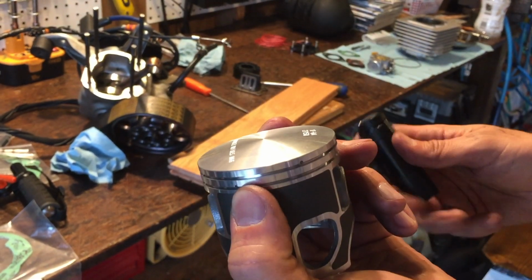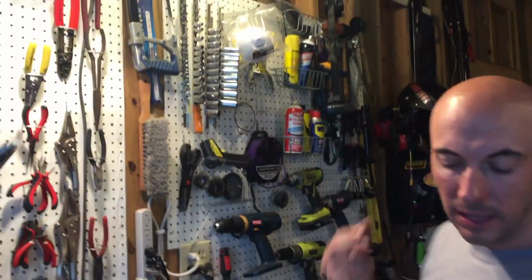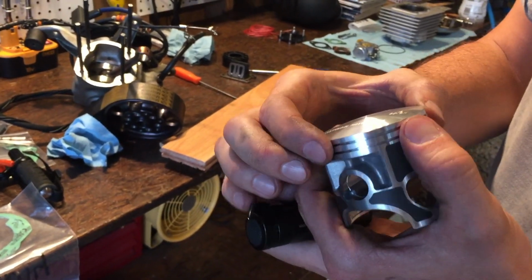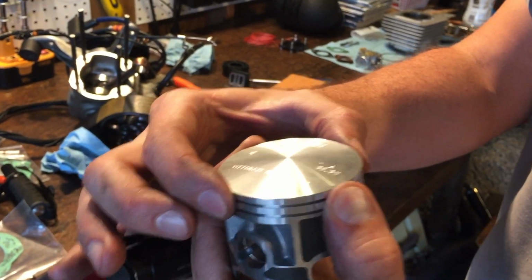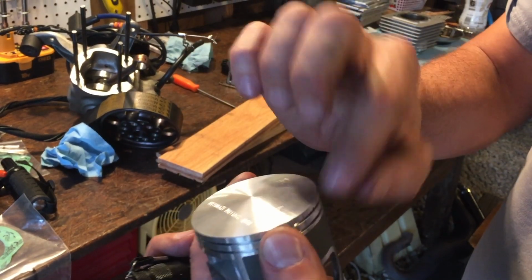There is a compression ring tool that you can use. It's this tool right here. I do not like it. These engines are so small, they're hard to get to. I just use my fingers, compress it, and have somebody start to wiggle, and it hurts, you get fingers pinched in there sometimes, but you just wiggle it down until it's sealed. That way you know the rings did not come off of their little pins.